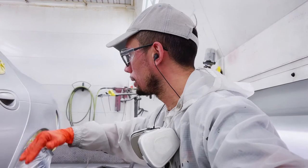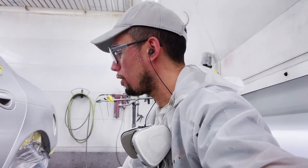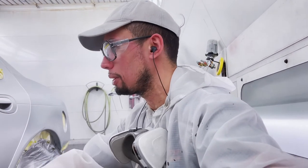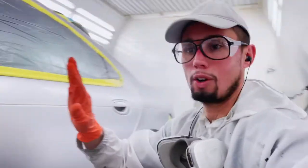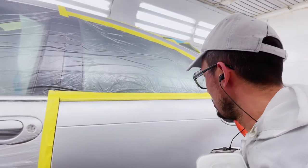What happens is I just blow a little bit of color in this area with my paint gun and then try to soften it up so that when it's disappearing or transitioning into the rest of the paint, when I clear it, it disappears — you never see it — the color matches this panel and the color stays the same, transitioning into the front which didn't get painted. So that's usually what happens when you blend.